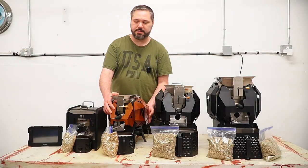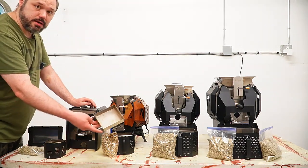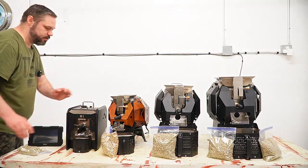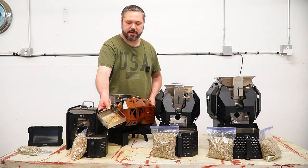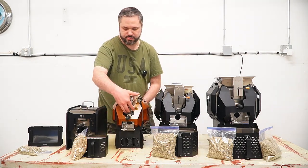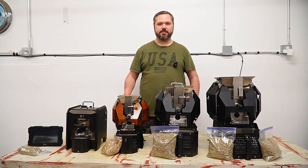On the M1, the chaff collector pulls out the front. On the M2, M6, and M10, it's actually on the side — it just pulls out like so and you dump it in the trash. You'll want to do that after each roast. Some beans have quite a bit of chaff. You don't want that chaff getting so hot that it's introducing additional smoke into the roast chamber.